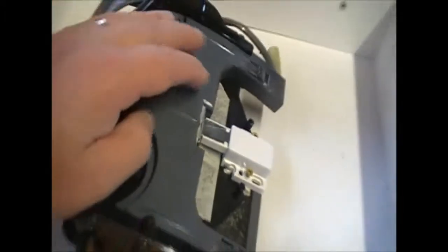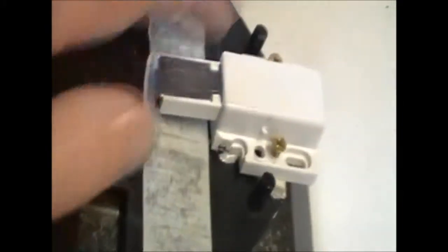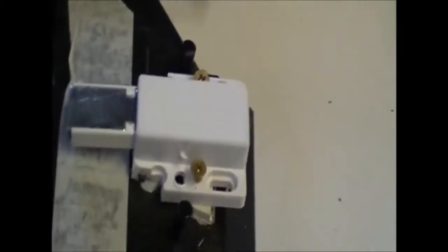Like I just put it in place where it needed to be, lined up with where the tape's going to, and the door obviously was like this. So when the silicone dried, then I could handle it and put the screws exactly where I needed them to go. If you go 2mm too far, the drawer comes out too far. If you go 2mm too far back, then the magnet latch doesn't work. So that has to be pretty much spot on, otherwise it's not going to work.